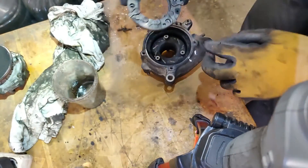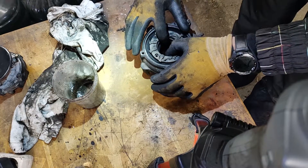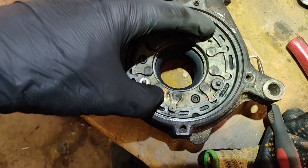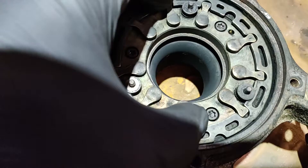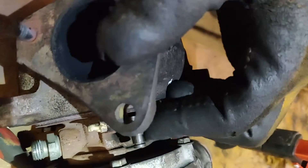The mark is supposed to sit here — this angle is back. Now it has really free movement; you can see how the flaps are moving easily and forming the airflow. The turbo actuator is removed, it should be done, the turbo is clean — we'll see.